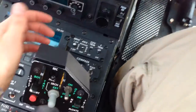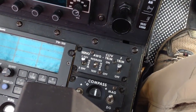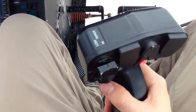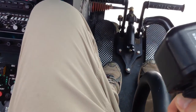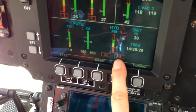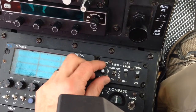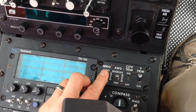You're also going to check your hydraulics. Put that into servo one off, then take your cyclic and rotate it clockwise with small movements, checking your hydraulics to make sure they don't drop more than the required amount. Then do the same thing with number two and go back to normal.